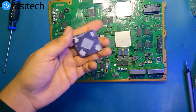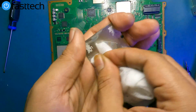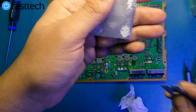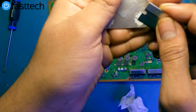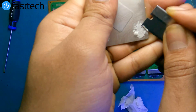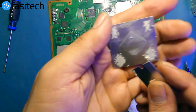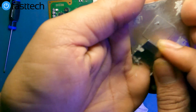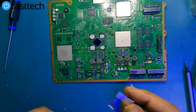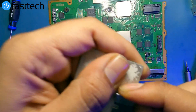We also want to clean the thermal paste from the IHS, which is in the middle. You can also use the blade from our kit to trim off the glue from the sides. If you don't want to do it on the RAM chips, I don't recommend trying that — you're going to end up damaging your chip. But definitely do it off the IHS; this is just a piece of metal, you can't screw this up.